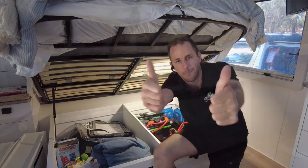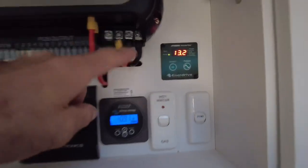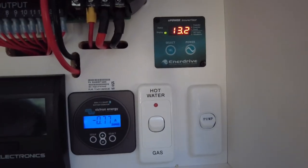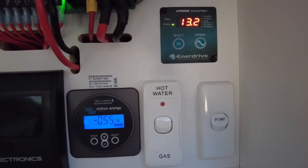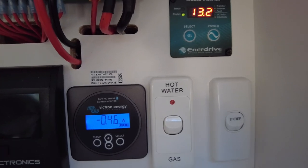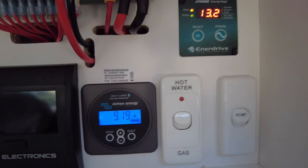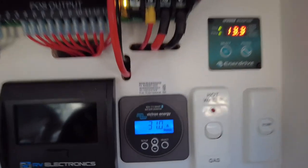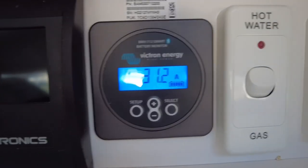Enjoy. So I'm going to get Ryder to plug mains in now, and you watch the auto changeover happen here, watch the flashing light. The inverter's still on, guys, all right? When you hear the click, that'll be the transfer switch engaging. And you watch that current fly up, because that'll be activating this charger. Right, there's the click. Charger's come on. Take note of the amps, see? So mains charger's kicked in now, guys.